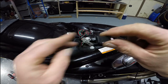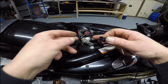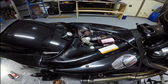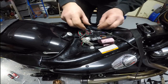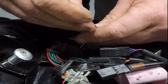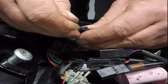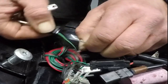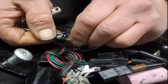And there we go — all four pins out. The good thing about doing it this way is you can clean those pins up with a little bit of emery cloth and put a little bit of electrical grease on there when you put it back together. That'll stop them from going green and save you from any electrical problems you might have in the future. For the other plug — we've already lifted the cap up — just push in and pull out, push in and out. As easy as that.